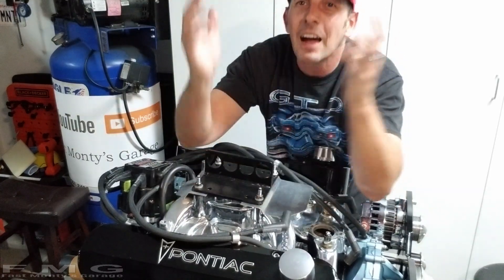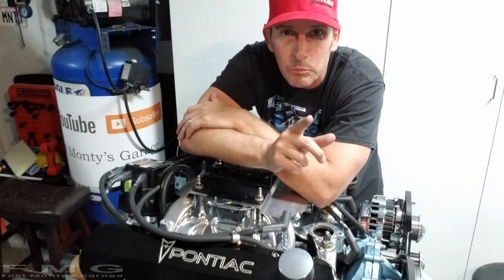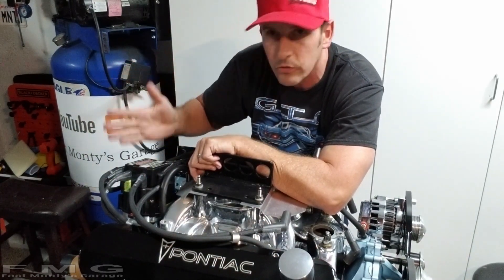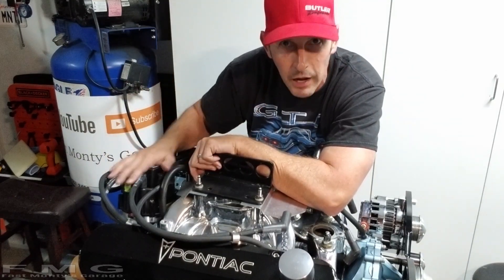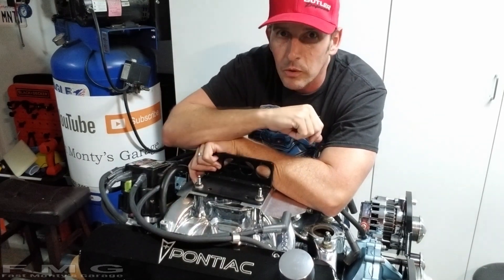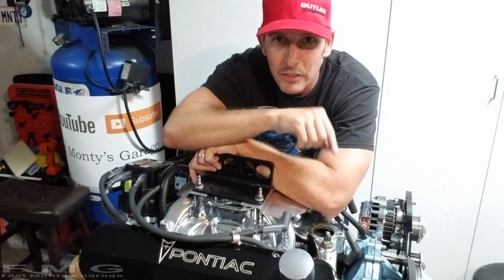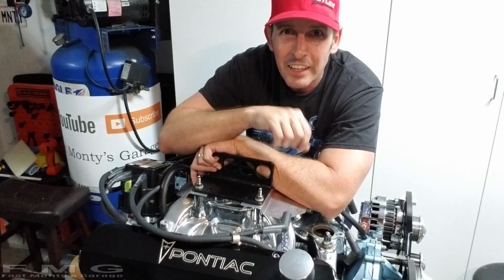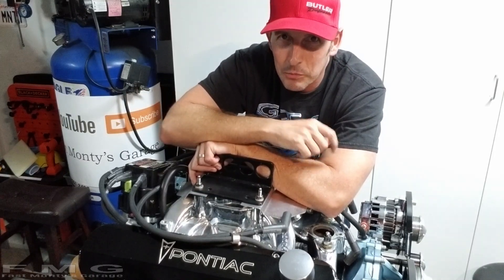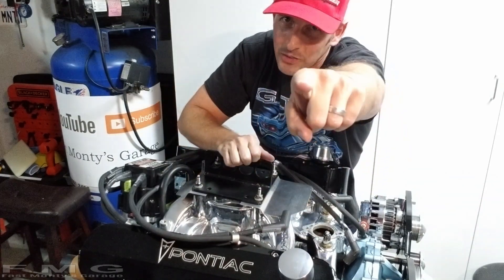We're all done — we can put the engine back in. It looks spectacular. The most important thing to note: set your wire locations before going in the car and mark on the block where your final setting is, so if you have to take the distributor out to prime it, it's easy to put back in. I'll put the firing order down below — it's counterclockwise — and that'll help everyone. Next week's episode is going to be awesome. It's a long-overdue project inside the engine bay before the engine goes in. Stay tuned, subscribe if you haven't, and until next time — build them fast and drive them faster!